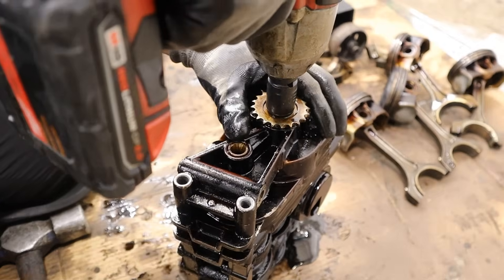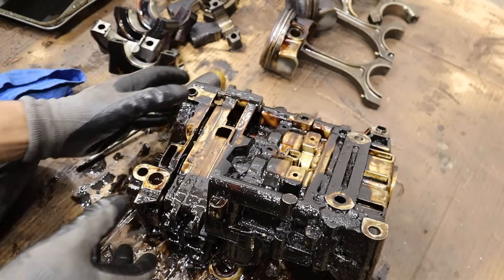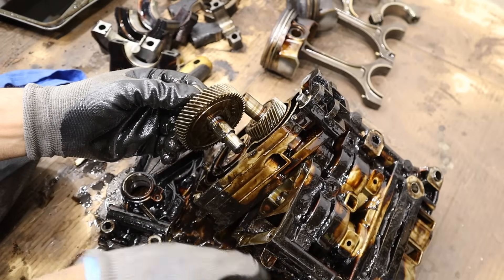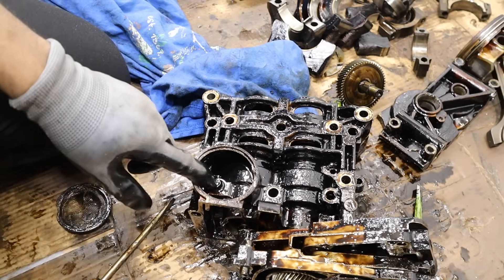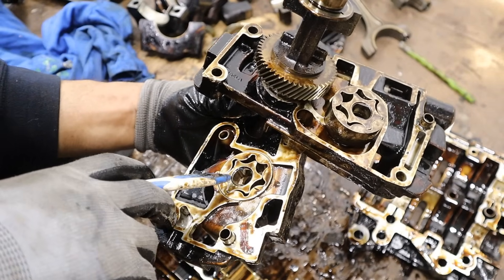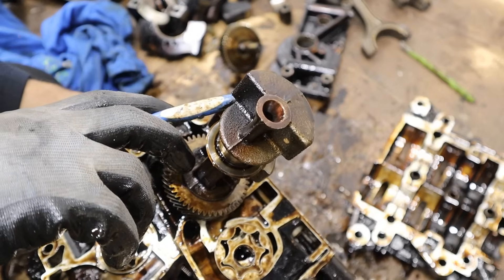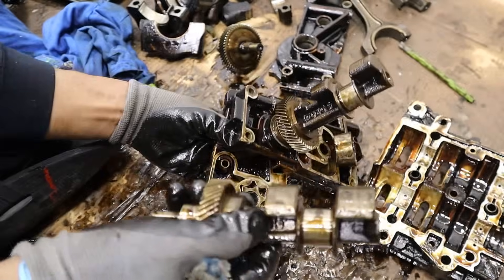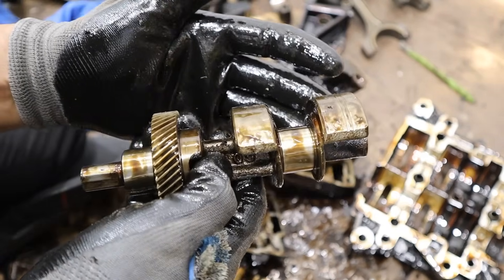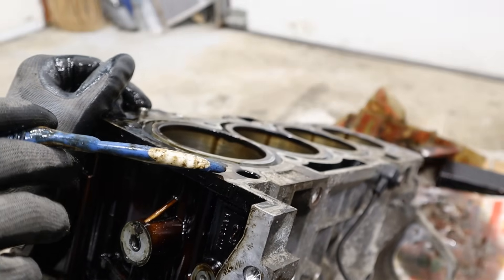Inside the oil pump assembly we have long bolts and an E22 socket — and it is reverse threaded. Once you pop the screen off there's a hidden 10mm bolt. Looking inside, there are actually two oil pumps — two sets of gears, one on each layer, that create oil flow. Of course we also have the balance shafts. Integrated in the housing is a giant spring — that's your oil pressure regulator. The balance shafts have weights timed to the crankshaft that eliminate secondary forces causing vibration. Moving back to the block, the main oil galley tees off to the timing chain tensioner and also tees off at the top to lubricate the engine head.